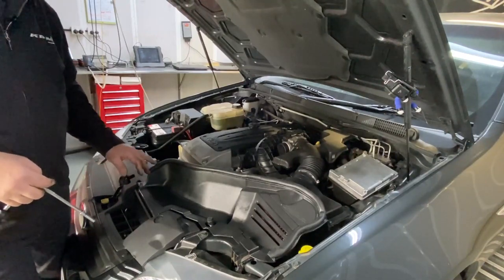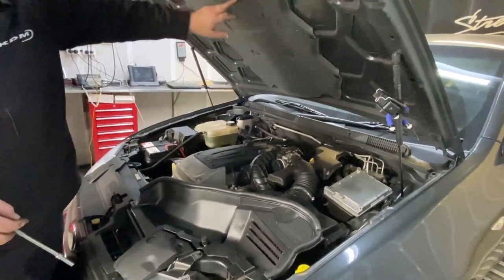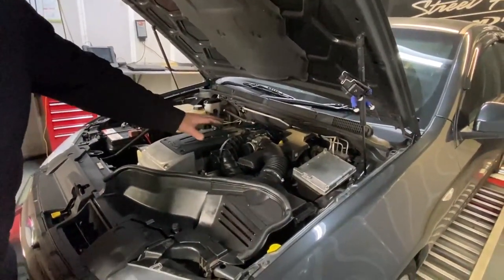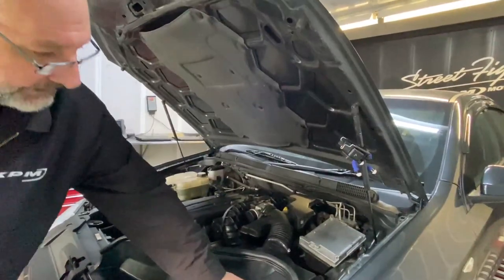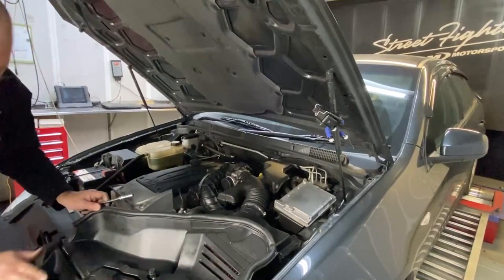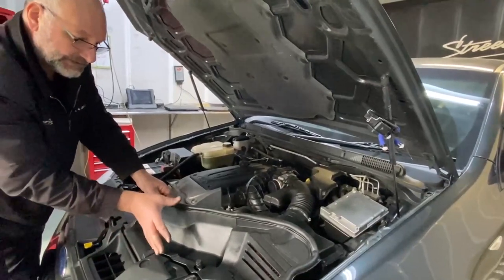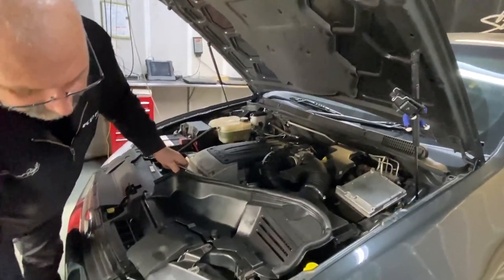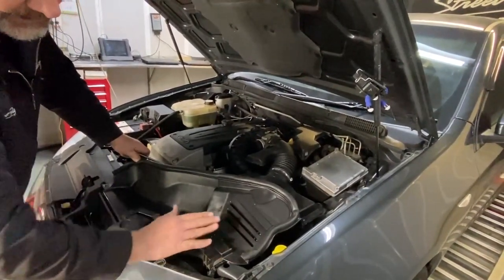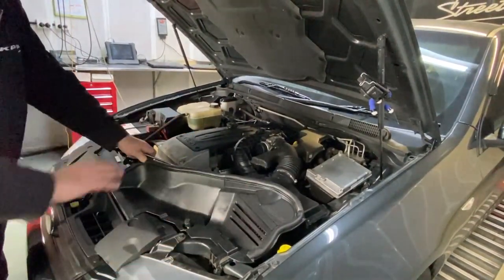What we've got here is a rubber seal that, once you close the bonnet, actually is made to seal on the bonnet lid. So that acts as a full tunnel that is enclosed from any hot air under the bonnet. You can imagine once you shut the bonnet, this seal closes all this area in, and you've got this massive front area here taking air from the grill up through the vent, through this massive tunnel, also taking air from directly over the headlight straight through these slits that we've put in here on our full cover version into a direct gulp straight into the air filter, straight into the engine.